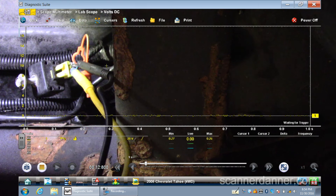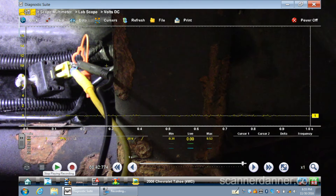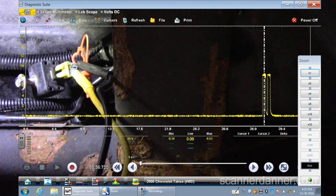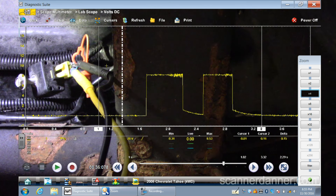Fred, can you cycle the key off and on for me? Key off — wait five seconds — turn the key back on. This is the bad sensor. On a one-second time base this time. Totally different looking — look at the difference in the time frame of it turning the sensor on and off: very, very small periods of time. And there is almost some activity there.